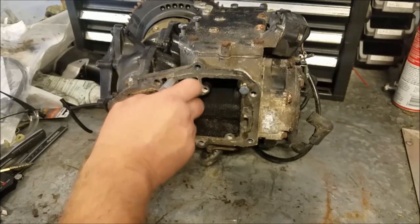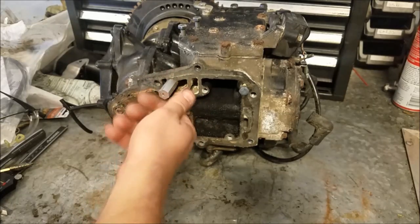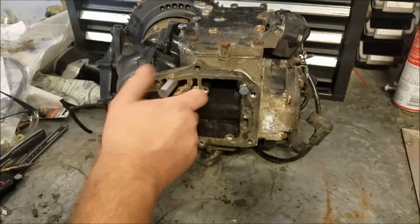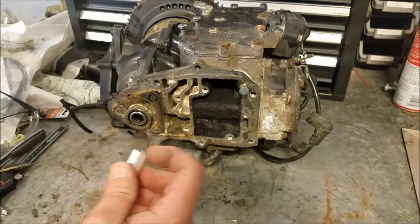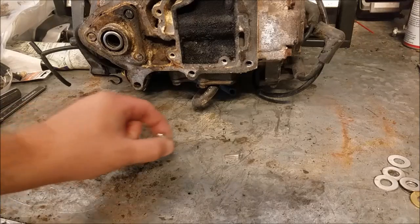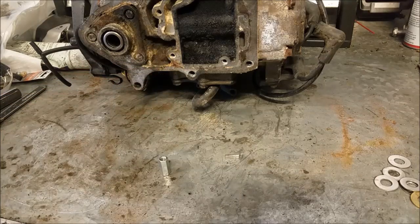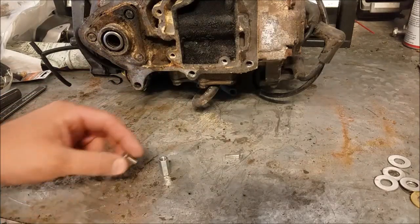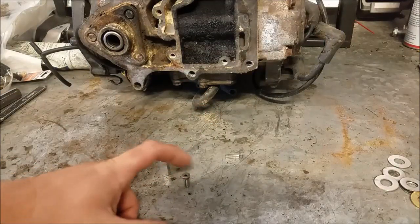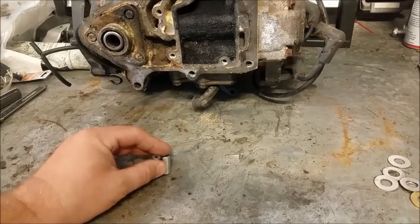There is a problem with this bolt — it is slightly bent. Ideally we would thread this in here, maybe tap it over with a hammer, and thread it in until it's nice and flat up against the block. But the fixture isn't flat. So Plan B: use a little quarter-20 collar because chances are that is nice and flat. And instead of using the guide hole, we're going to use a drill guide that should prevent the drill bit from rounding out the outside of the holes. This should fit inside of there and work pretty well.